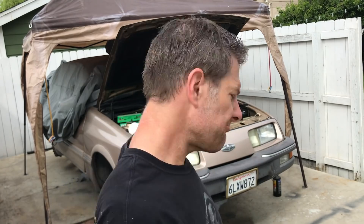As predicted, flow to the front is good. I'm just gravity bleeding right now, letting fluid flow through. The fluid has further to go to the rear, so tying off the fronts — when I press the brake pedal it squirts out of the fronts, so they've got plenty of flow. Now we'll see if we can get something out of the rears.